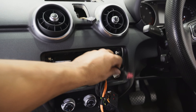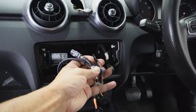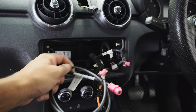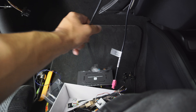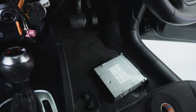First step is video. This pink cable here is the video cable. In the kit you're going to have a supplied grey cable — grey is going to go to pink with the female connector — and then we run this to the module. From the module, a new pink cable comes up and takes its place. The original connector plugs into the grey coming down here, and the new connector runs up behind the dash over to here, going back into the pink port of the radio.